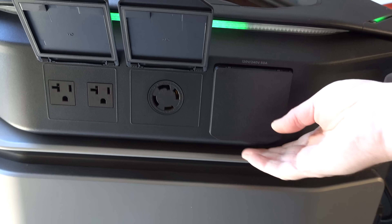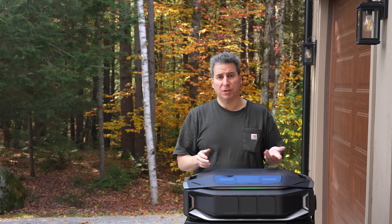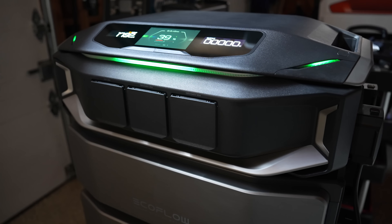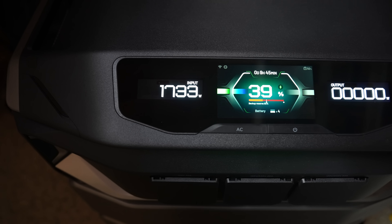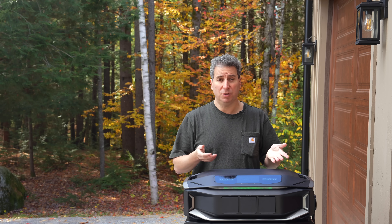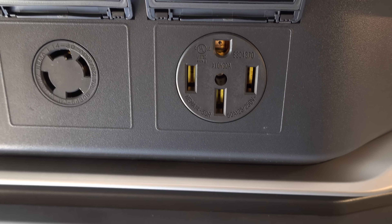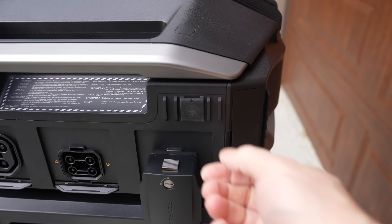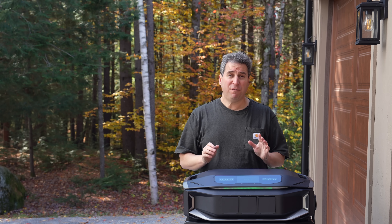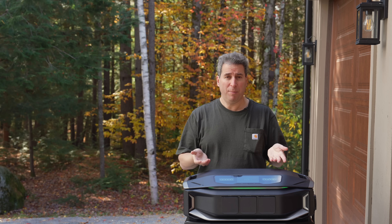Some things on the outside have changed. They got rid of some ports — they eliminated the USB ports and reduced the number of AC outlets. Other external changes include the display and the LEDs. The original had a great easy-to-read display, but this one has now been improved with a full-color display, and they've also got an LED status bar across the unit. The unit still has the same type of AC outlets, with the exception that this new one also includes a brand new 50-amp outlet, which is required if you're going to use the full 12,000 watts. For some installations, you do need to actually ground this thing like you would a generator — there is a ground screw hidden away on the side.